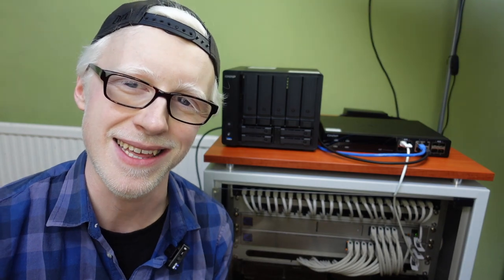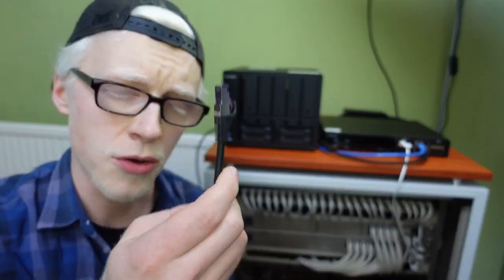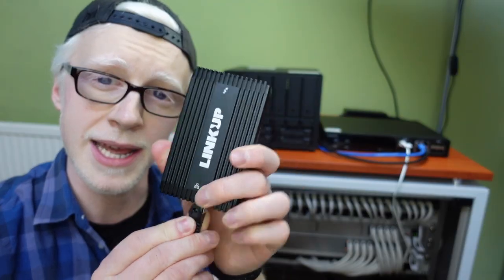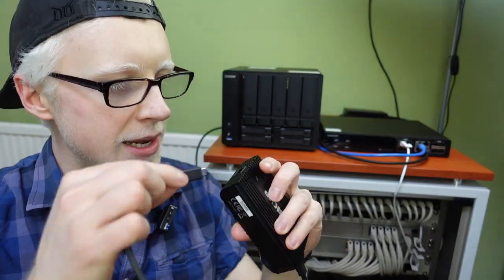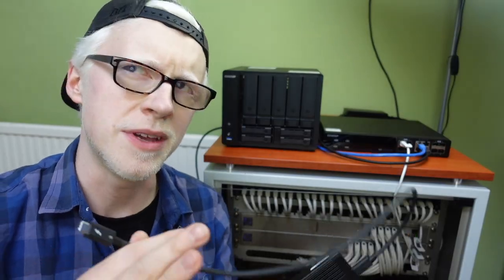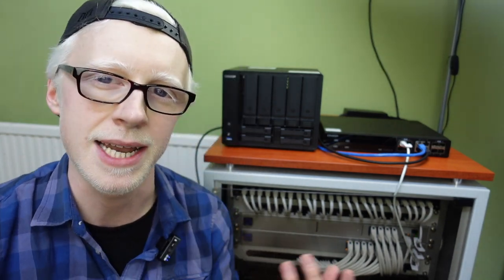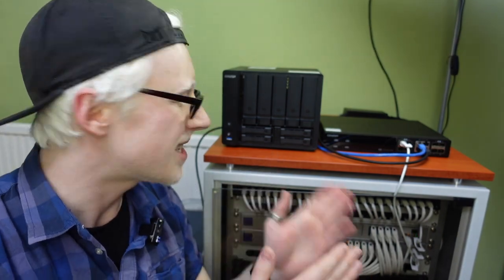Here's the other end of that cable. I've got a Mac Mini M1 and it famously doesn't have 10 gig ethernet — not even as an option — so we can use a simple adapter. You take your RJ45, plug it in, and on the other end we have a USB-C. That goes in and you have Thunderbolt or USB-4 to 10 gig networking. If you're on PC with a desktop, you can just plug in any 10 gig PCI card you find off eBay.